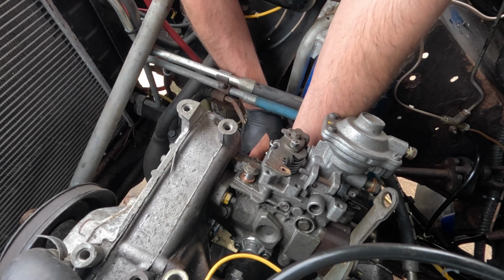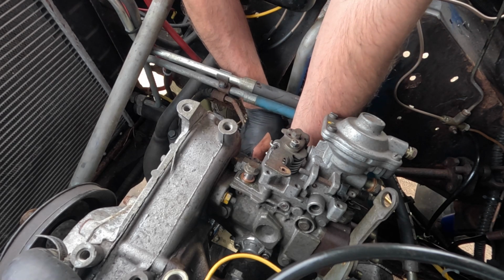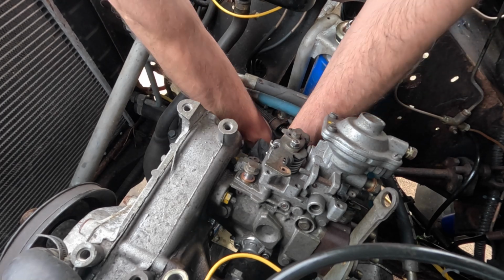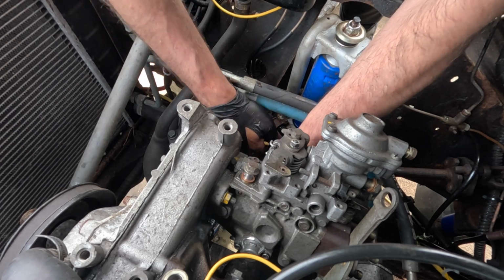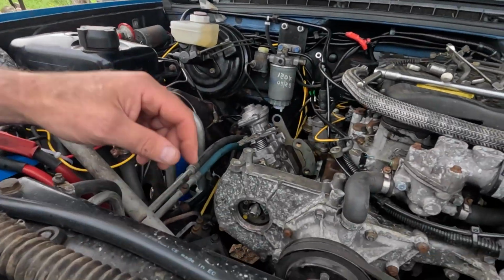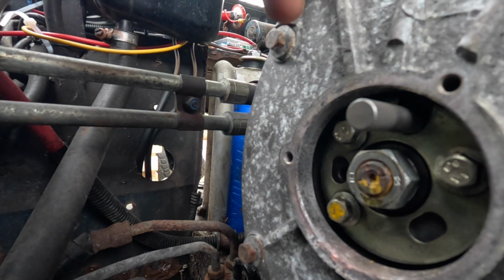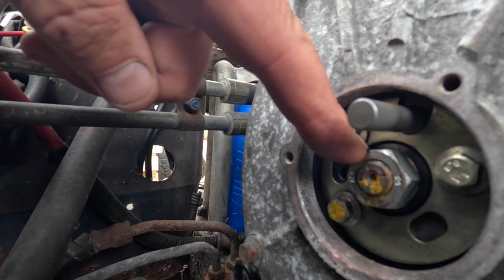Take the tension off of these, and then we'll have to go around the front of the pump again and use the new special tool to hold the pulley. That's it, that's 3 of them. To hold the timing gear in place. Okay, we're back round the front of the engine now, so the next job is to remove these 3 bolts which hold the sprocket to the pump, and might have to put a socket on that nut to stop everything spinning.